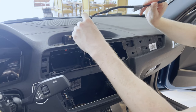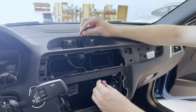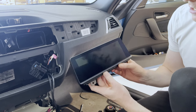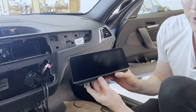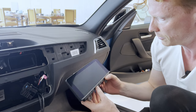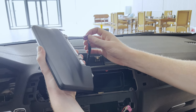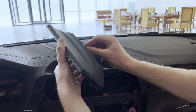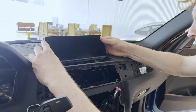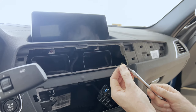Now we're going to route the CID cable with the darker shade of pink on top. We're now going to install the CID — this is actually officially the first part of the rebuild we're installing, so it's pretty exciting. It's brand new — a big thank you for sourcing this. We connect the pin connector, carefully drop it down and place it in position, then secure it with two T20 screws.